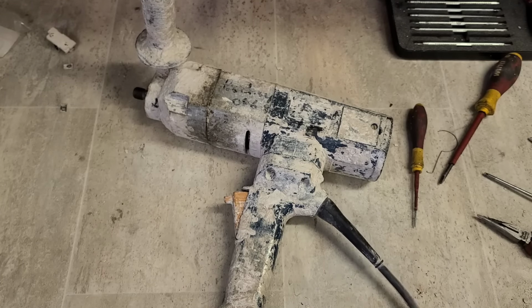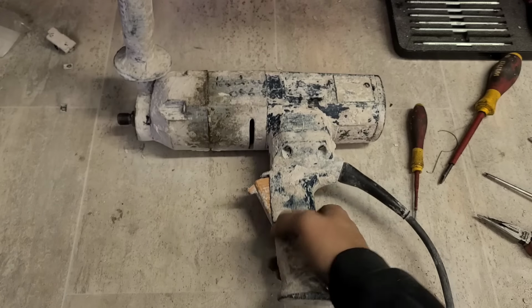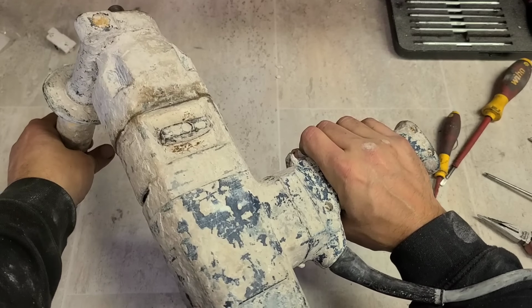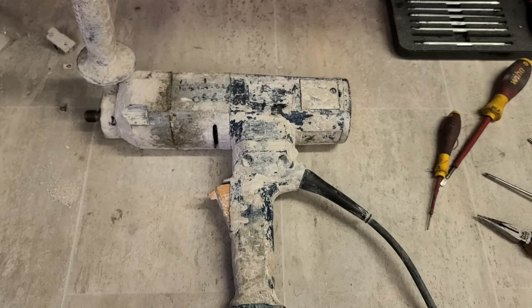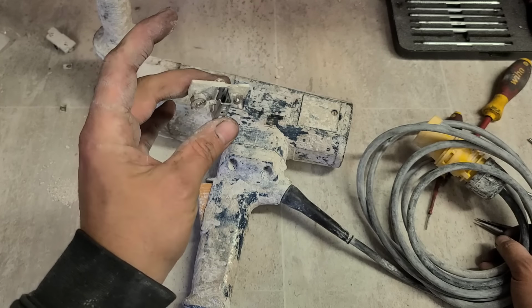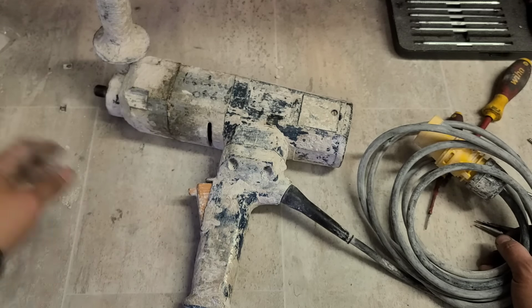And that should sort that. That should be her. One Bosch GRW11E mix and drill, with a broken screw on the brush holder holding on the brushes. All it needed was a new brush holder. We just replaced the two, just to be sure, and new springs as well.